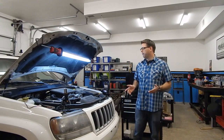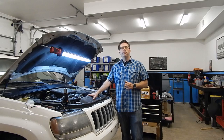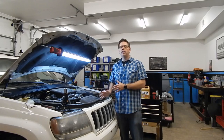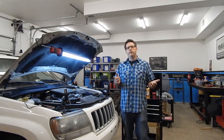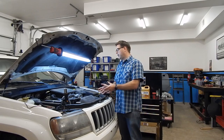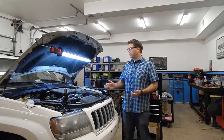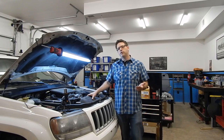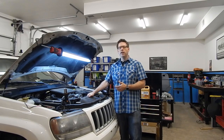We're going to be replacing the water pump on this Jeep Grand Cherokee with a 4.7-liter V8. Changing a water pump on these is actually pretty simple. Whether you have the V8 or the 4-liter inline-six, there are differences in the water pump. There are also different fan setups on the WJ. Some inline-sixes use a mechanical fan with an electric auxiliary fan. The 4.7-liters use a hydraulic cooling fan, which is run off of the power steering fluid — kind of a neat thing.